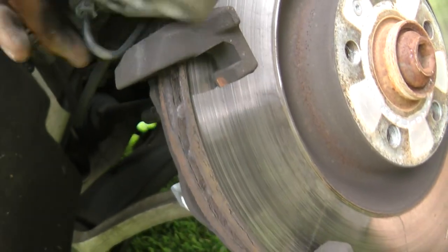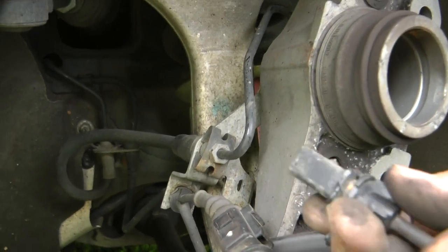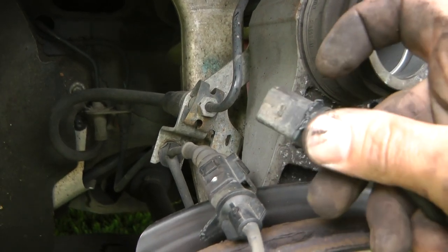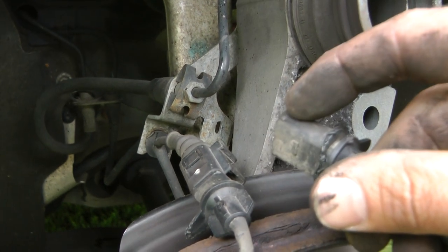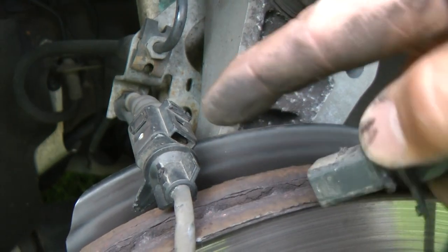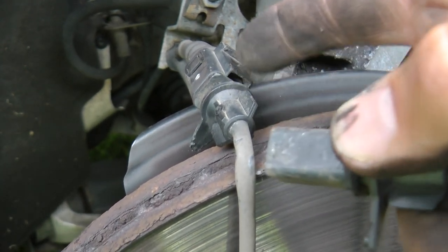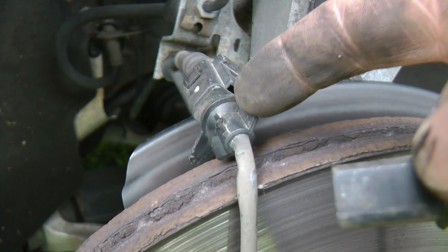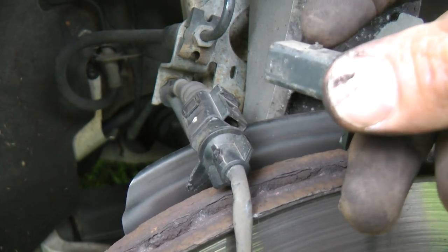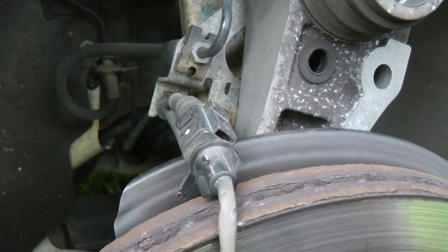Now hang this up so it doesn't wreck the brake line. This step in the pro videos is simply 'unplug the connectors.' For us amateurs, sometimes it's a little more difficult than that — I really struggled getting this one apart. There's a little tab; the curved part is here and on the top is a tab which is under here. You have to pry the female part up in order to get this male part, which is attached to the brake pad, apart. See if you can slide a screwdriver under here and then pry this back.